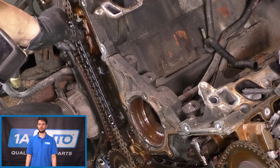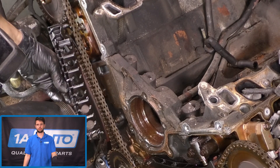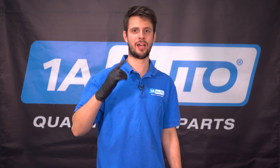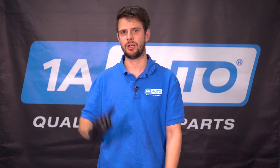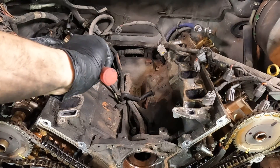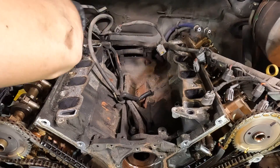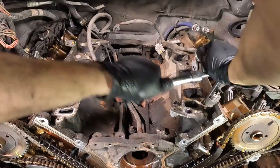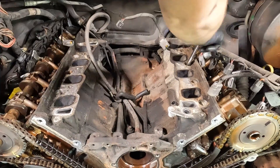You can see right here is our problem. This is the rest of the broken timing chain guide, and it's so broken that it's not even holding on anymore — I can just freely remove it, even though it's supposed to be bolted on. Now that the timing chain is exposed, let's time this engine and put it at top dead center. This is the two-valve 5.4, not the three-valve with variable valve timing — that one's a little bit different. Regardless of what engine you have, it will make things a lot easier if you remove your spark plugs. As you do this, try to feel for how tight they are, because this engine is notorious for having spark plugs get loose and then shoot out of their spark plug holes, which will ruin the threads and can cause other damage. So pay attention to it and address the problem if it's there.